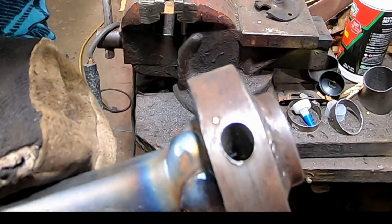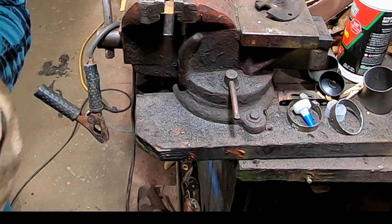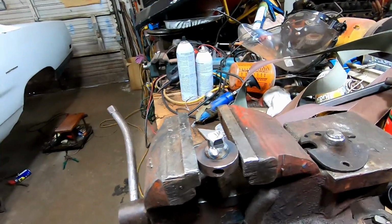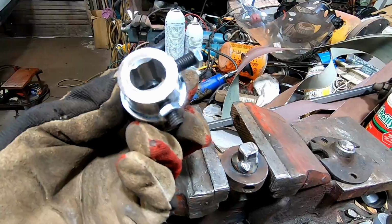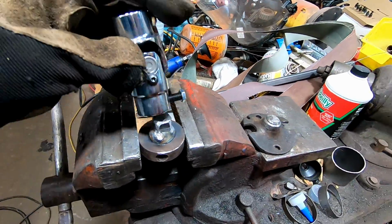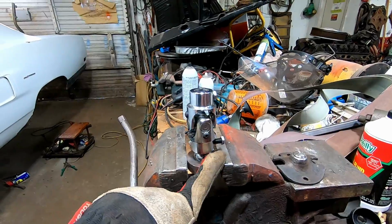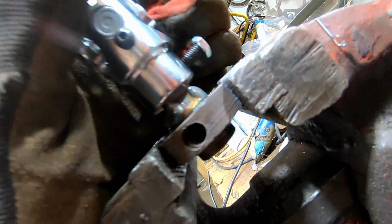I got good penetration there. It's very hot, but I got a good little blue line. There's our little end we just welded on. I got her cut off and beveled, so it'll start into our joint. Then I just ground the end of the joint, so she slides on real nice just like that. I can now stitch that up right there until the cows come home.